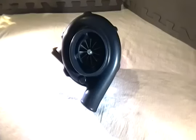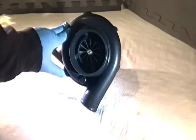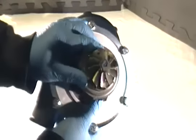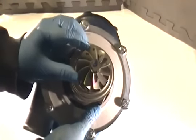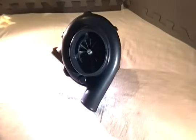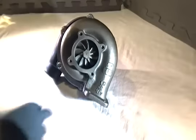The purpose of this is to solve the GTX 3076R problem, especially for the two-liter to 2.6-liter class of four and six cylinders. The GTX 3076R used a fantastic compressor wheel — this one actually uses the exact same compressor wheel and compressor cover as the GTX 3076R — but the thing that was addressed most was eliminating the turbine wheel to compressor wheel mismatch. Instead of using the standard N32 60-millimeter exhaust wheel used in the GT30R, GTX 3071R, GTX 3076R and others, this is now using the same exhaust wheel as the 35R: the N111 68-millimeter 35R exhaust wheel.